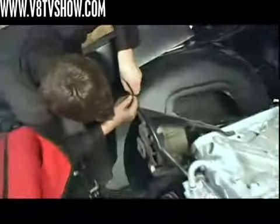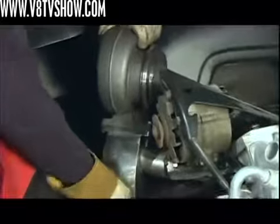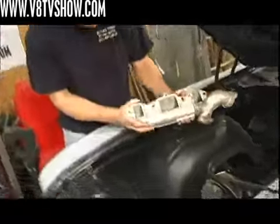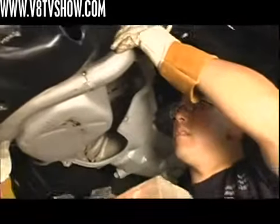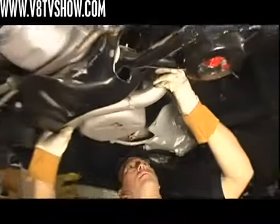The factory inner fenders are plastic and the turbo was actually touching the inner fender well, so we cut it away knowing we'll later fabricate a steel heat shield conformed to fit around the turbo without interfering with the tire. Getting the exhaust out of the engine: the driver's side goes underneath the engine and meets the passenger side manifold at a factory cast-in boss. Oldsmobile used that passenger manifold as a Y-pipe in single-exhaust cars, so we use it to join the two. The exhaust then loops underneath through mandrel-bent tubing and joins the turbo inlet pipe with a V-band clamp.